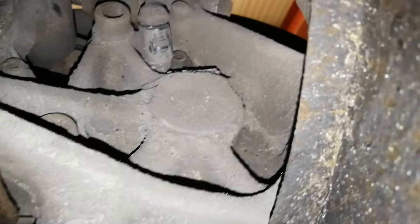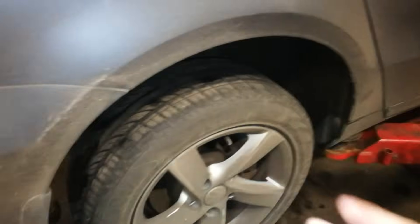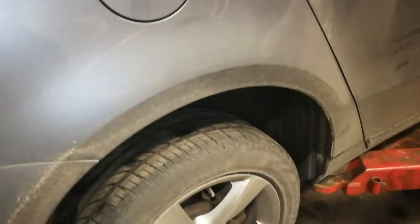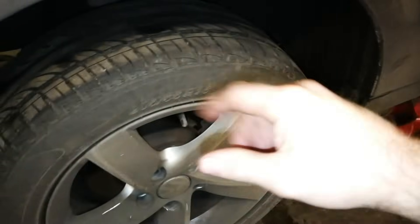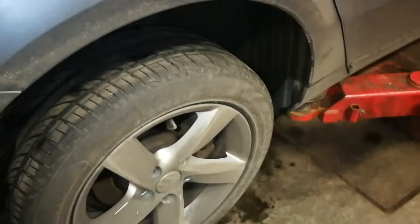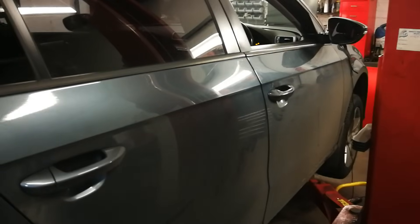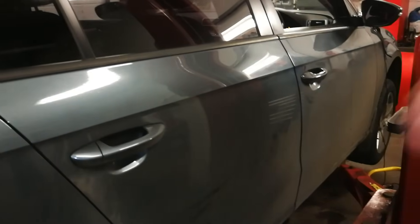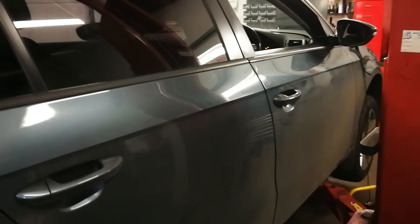I have the vehicle lowered down and I have my VAGCOM hooked up to check the wheel speed sensors - I'm just going to spin each wheel and get a reading. This is where a wireless Bluetooth scan tool comes in very handy because you can have the scan tool beside you as you spin the wheel. Unfortunately mine is out of action at the moment so I'm using VAGCOM which is a wired system. I'm going to set the computer up so you can look at the screen, starting with the left-hand rear wheel, then right-hand rear, right-hand front, left-hand front - that's the sequence you will see on screen and you will see any changes as I spin.